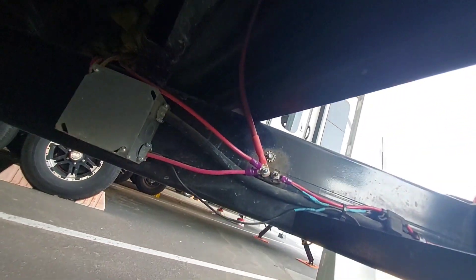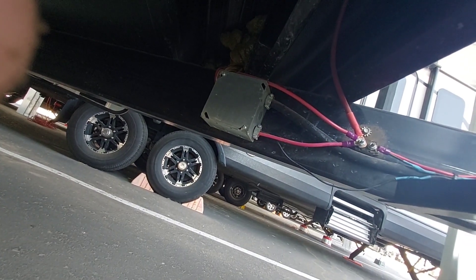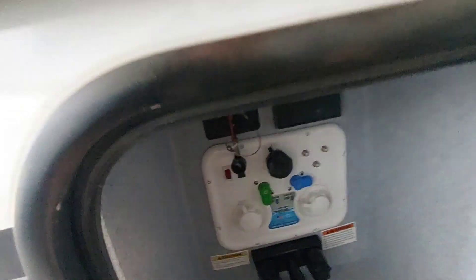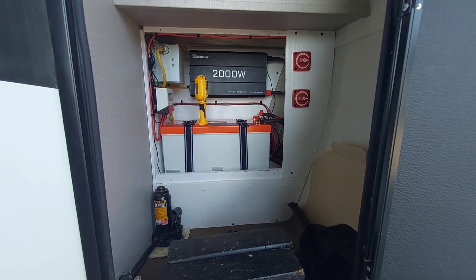I left that the same. Here's my six-gauge wire — I ran it up there, then down to here, and then this is where it went out to the battery tray to the positive. All that goes to is the emergency brake and the power jack up there, and then it goes into this box and just forks off everywhere. That's why I didn't want to change anything. Inside here is the original switch, so this will still work.